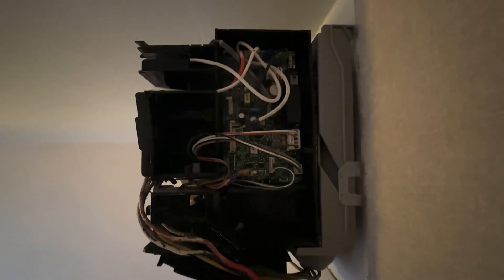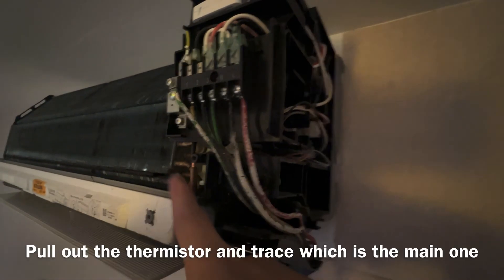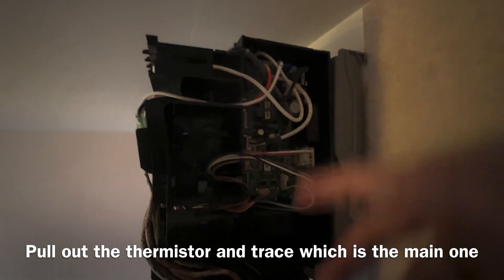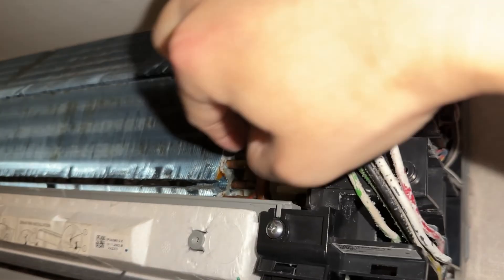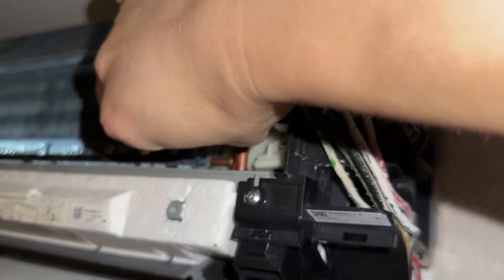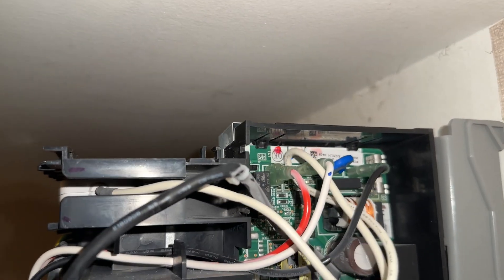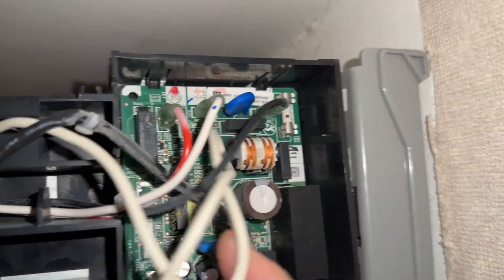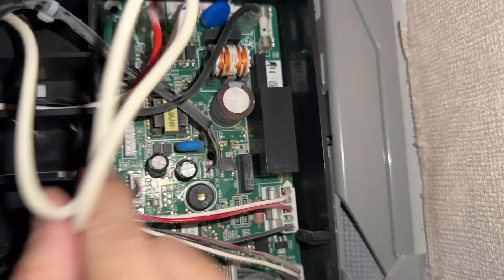So I need to locate where the sensor is. Actually pretty simple — all you need to do is pull it out from here, then you get to see where the sensor is located, the other side of it, and just replace it. I'm going to pull this out. This is the thermistor, or we call it the temperature sensor. I think this is faulty. Now I know it's in the middle here, next to this blue part. So I just need to take this out and replace it with the new one.